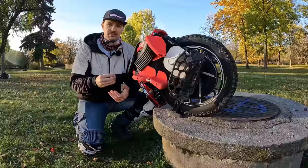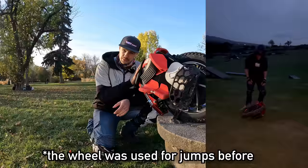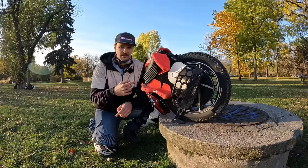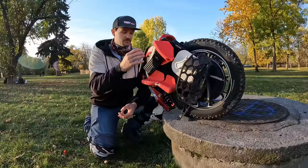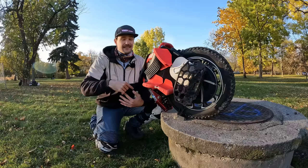Now, Anthony, a rider from the UK, had a huge problem with it, and I was just a little flabbergasted why this happened. Essentially, the wheel just fell from such a height, like nothing should have happened. But after that, I believe the board fried. He had to change the board. After changing the board, it didn't have the connection with the BMS, so the wheel was out of service. He changed the BMS, the problem was still there. So essentially the whole battery pack, the motherboard and the motor was new, but it still wouldn't work. And then he had to desolder the BMS, put it on a different pack, and then it would work.